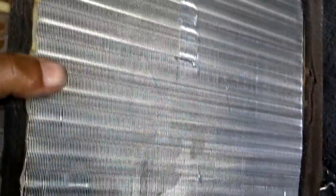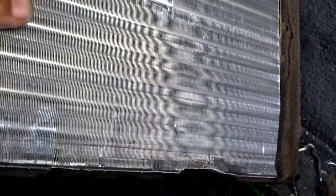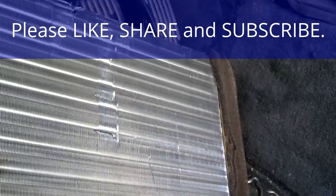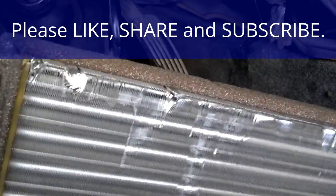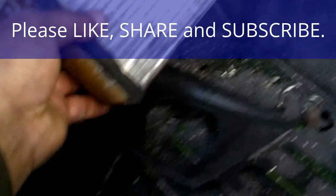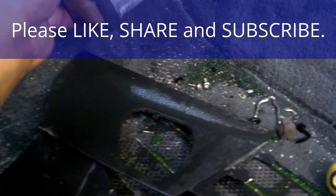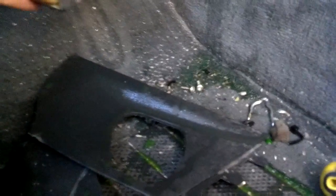So you got to decide if you want to put that stress on your core when coming in and out with it. So let me try to slide it back in, see if I could get it in without doing as much stress as I did getting it out. Okay, assuming I have a new core here, I'm going to put the foam around it like was on the one that I took out. I'm going to put the bottom of the core in and try to get it started, working the top of it in. Let me see where I am.